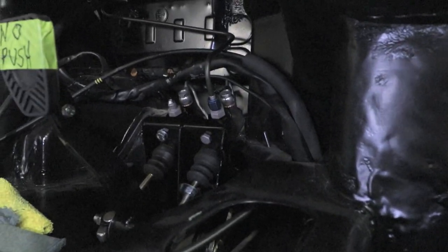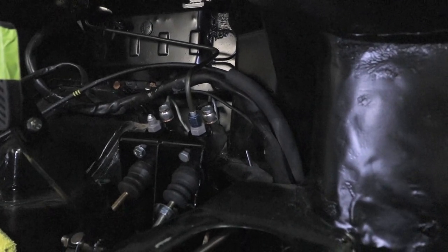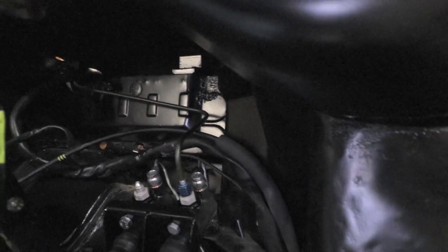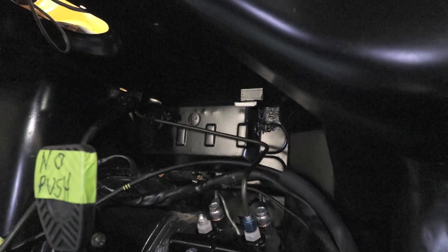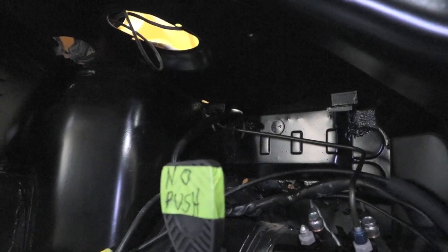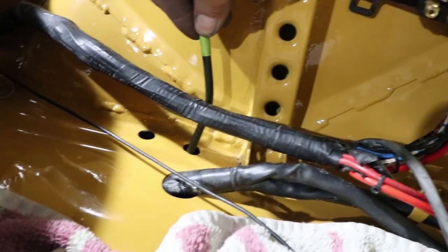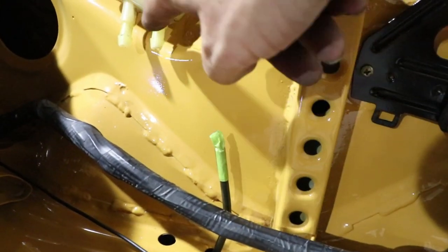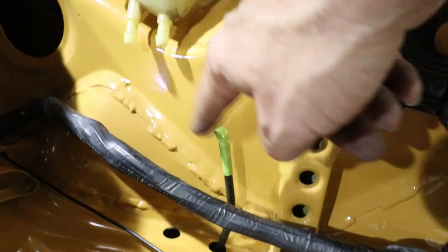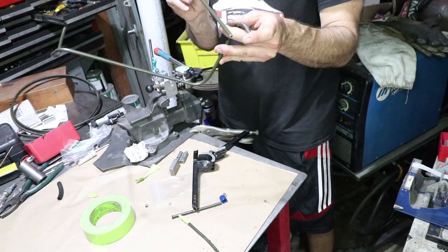It's a little hard to see in here because it's just so black. But you can see that blue piece — that's right where the line attaches to the master cylinder. It quickly takes a turn and goes up along the back against the wall there, and it's sloping up. It'll slope up a little bit more once it's attached to the reservoir on the trunk side. It goes through a hole just behind the wire harness, and inside here you can see this is taped, but this will get pulled up with a grommet. Then it'll just get a flex line to go between these two.